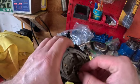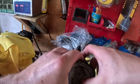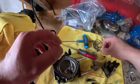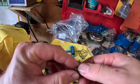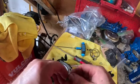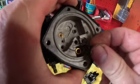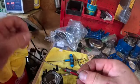Okay, you're going to take and push your seat in with the O-ring on it. You'll feel it fit down in there nice and tight. Now you're going to put your holder back on, your little metal clip that holds it in place. I also ultrasonic cleaned this just to make sure it had no flakes of garbage. Magnetized Phillips works the best for this, guys. As you can see, it goes down in here, right here. So let me get that in there. I'll do it off camera.